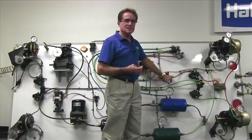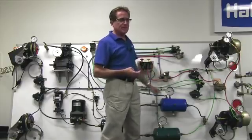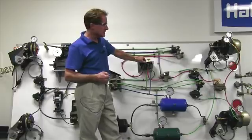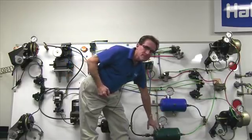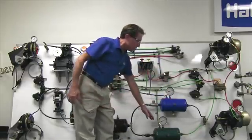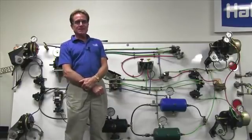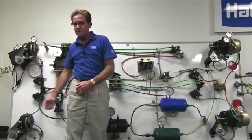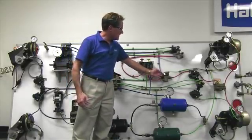The reason we need this is there is a stopping distance requirement for the emergency brakes. The confusing part is most people think of the spring brakes as the emergency brakes, but they are not — they are parking brakes on a truck and a tractor. The emergency brake system since 1975 has been the dual air brake system, meaning a separate primary brake system for the drive axles and a separate secondary brake system for the steer axles. In order to meet the emergency stopping distance when we fail our primary brakes, we can't do it with just two small brake chambers up front. We need to modulate the spring brakes during this condition, and that's the purpose of the inversion valve.